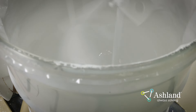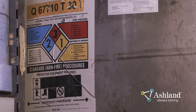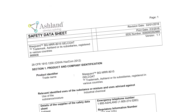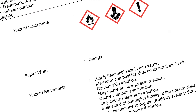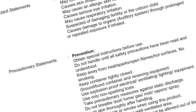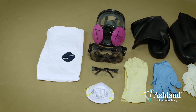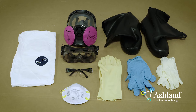Safety. Be sure to follow all safety procedures outlined by OSHA in your manufacturing facility. Before working with Gel Coat, review its Safety Data Sheet. Take note of all safety precautions and use PPE recommended by the Safety Data Sheet. To safely work with Gel Coat, a respirator, eye protection, impervious clothing, and gloves must be worn at all times.